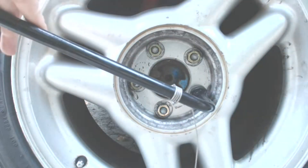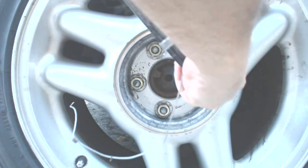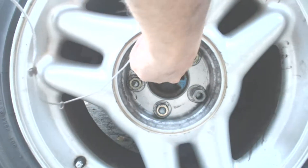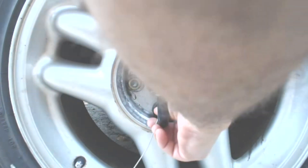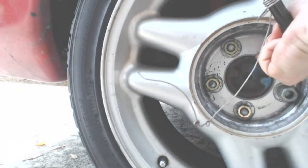When reinstalling your tires, don't forget to tighten them in a star pattern. There is a torque specification for this, but I usually get them as tight as I can with the standard tire iron that comes with the car. I go around them at least twice, sometimes three times, to make sure they're all uniformly tight.